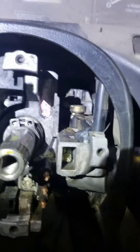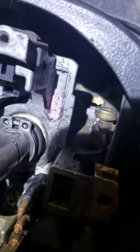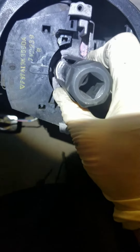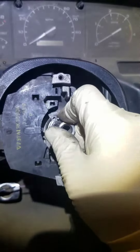What I wanted to talk about was getting this spring and C-clamp back on. There are two notches here — one here and one down there — and this is a pretty heavy-duty spring. What I ended up doing was using the oxygen sensor socket, put it on there, and just hammering it on.